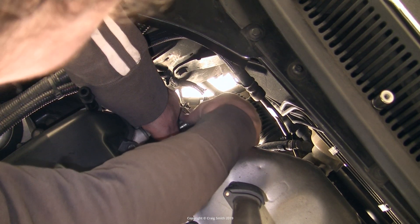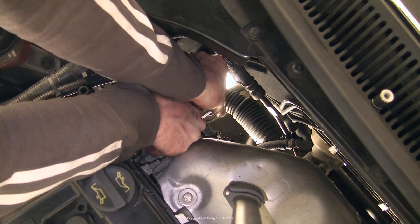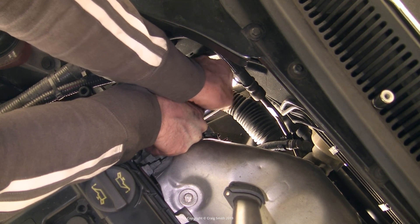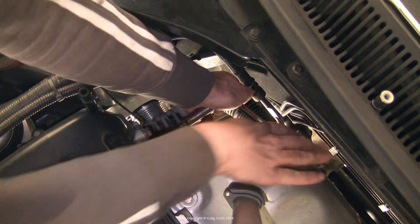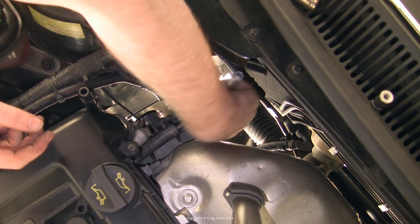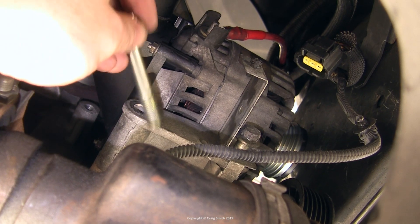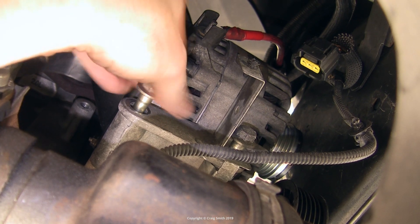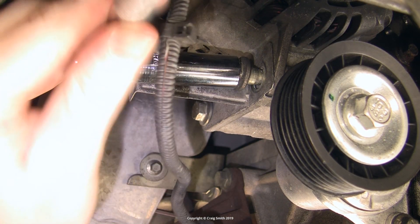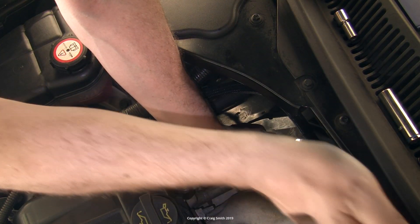It's hard to see, so I kind of had to do this by feel. The trick is to get the bolt safely threaded into the hole while keeping the weight off it, because otherwise you risk cross-threading or even ripping the bolt out of the hole if you put all the weight on it when it's only got one or two threads engaged. Once the bolt's threaded in, I used the ratchet handle to do it up, but I left it loose because the bottom bolts need to go in first so as to correctly position it before it's actually tightened. Do be careful with these — if they won't go in, if they jam up when turning them in, then stop and check that they're properly square and lined up. You don't want to strip a thread. I snugged them down with the ratchet, and when all are in place it's time for the torque wrench. The tightening spec here is 47 newton metres.